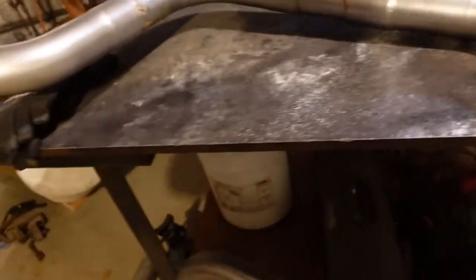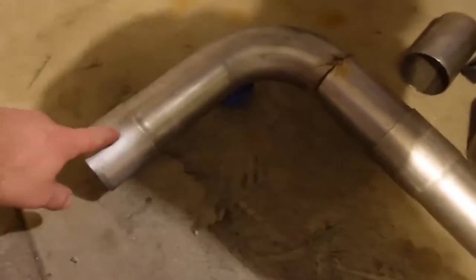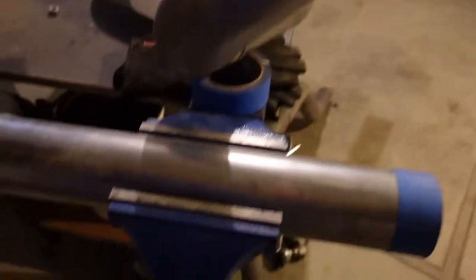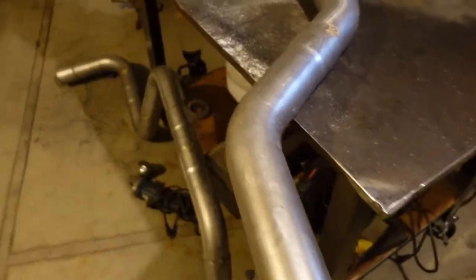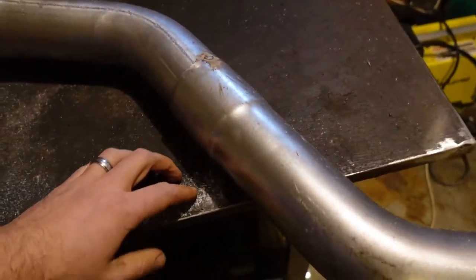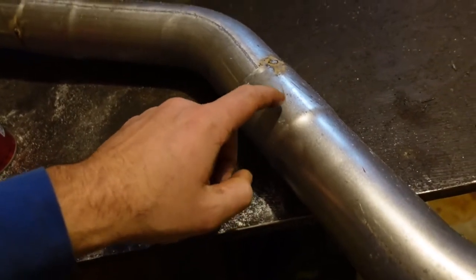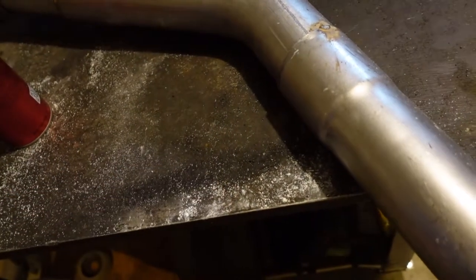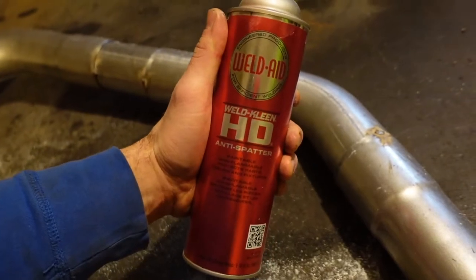I got it all tacked together, so we'll get it all welded solid, and then we'll figure out what I need to do for this other tip — I was going to cut this flared end off and weld on some straight pipe, so it's all the same diameter and both tailpipes will be even. Also going to be using some anti-spatter spray to help keep the welds looking nice and clean. When I did the H-pipe I didn't use it on those first welds, and the spatter doesn't come off this aluminized very well like it does on bare steel. But when I welded the mufflers on and used this anti-spatter spray it really helped. I'll link it down in the description below — it really can help keep your welds a lot cleaner. Let's get burning some wire on this stuff.